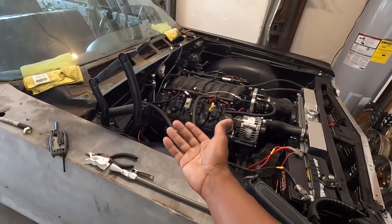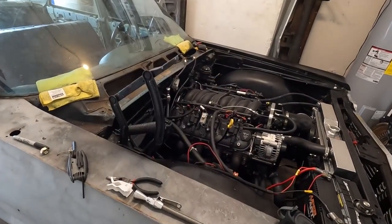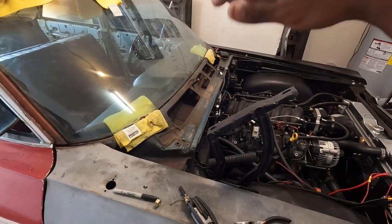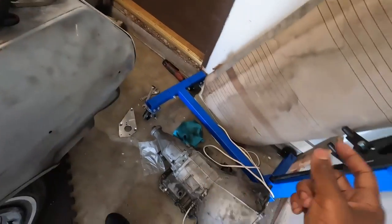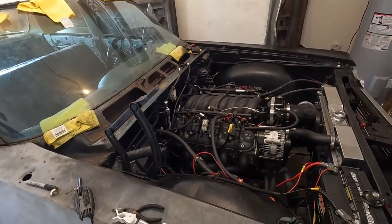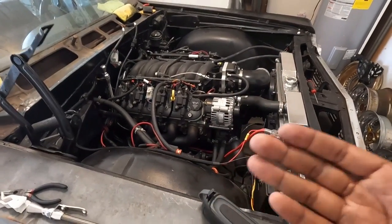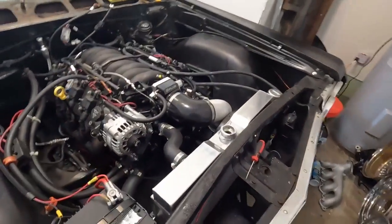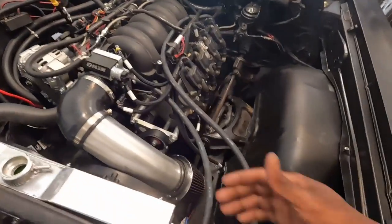You're also going to have to use a spacer to lift up the back end of the engine and transmission. Everything is close but it fits. Everything mounts in the factory stock position — if I wanted to go back to my Power Glide and the 350, I wouldn't have to change anything about the crossmember, the trans crossmember, or the engine crossmember. I could really go back to stock if I wanted to.